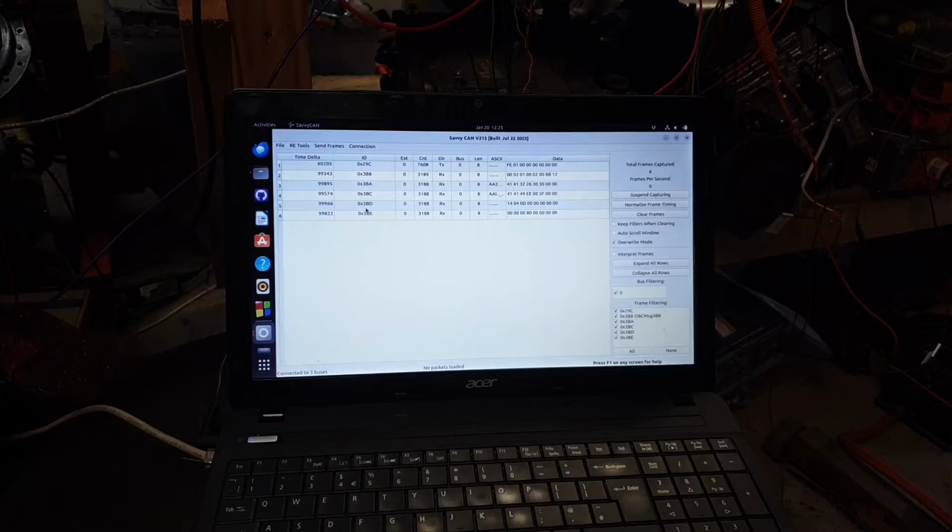I also think that this charger should be fairly simple. I wouldn't be at all surprised if it finds out that ultimately we really only need one CAN ID to run this thing, and that being 29C, and that the reason it's steadfastly ignoring me is just down to those analog, we'll call them, signals.